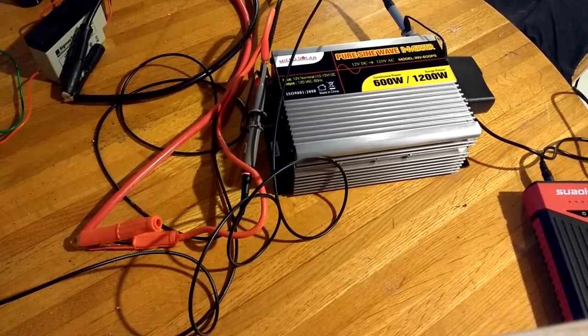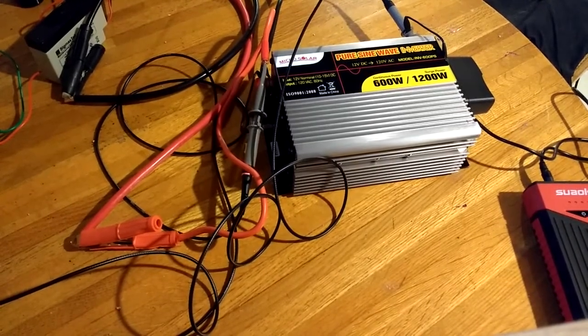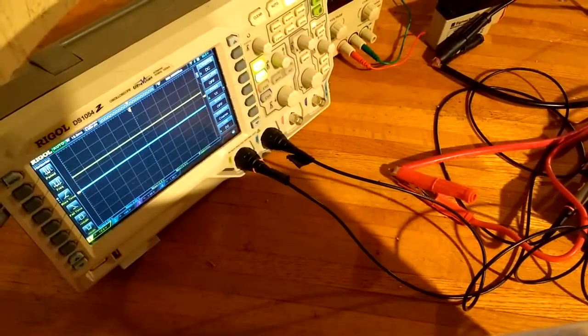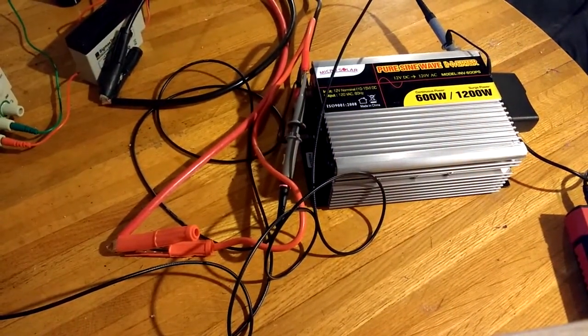What I was doing is taking this inverter and running it off of the truck battery, then powering a data acquisition system and also an oscilloscope so that when it would glitch we could see if we were getting a bad signal and see under what conditions it was glitching.